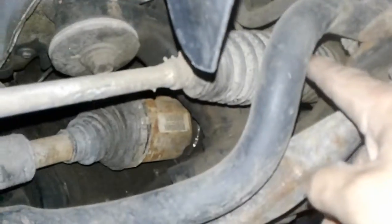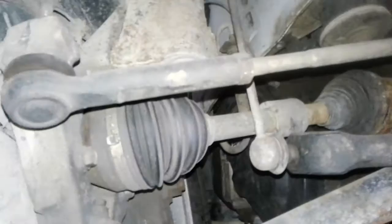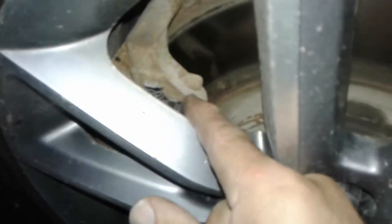Your inner CV boot is dry, and just a quick perusal of the bottom of the motor — no visible oil leaks that I can see. Your rotors are not new but they're not scored. Your brakes have got about 60%, or about 30,000 K left on them, and your outer tie rod is good and solid, which is critical.